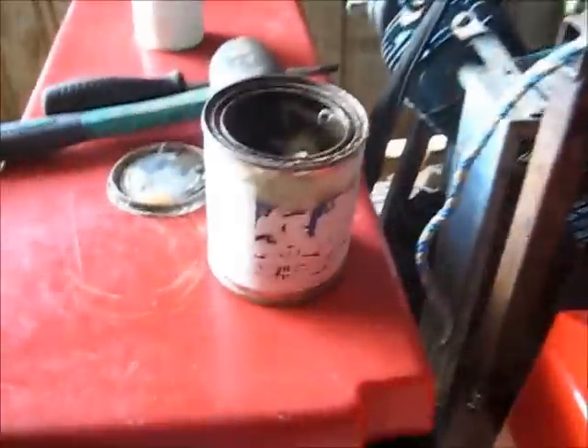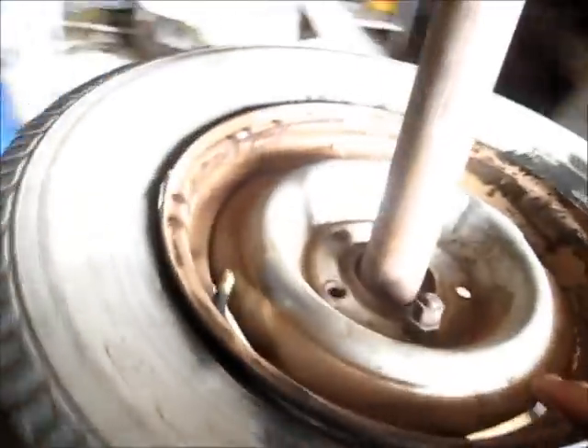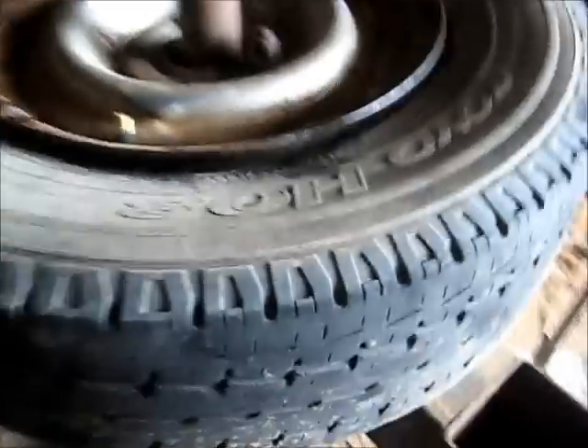With all these tyres, they're so much easier to fit when they're fresh. Good bit of piping lube — end into that, wind it in. Perfect. Just going to give it a tap, make sure the bead's evenly pressed. It's all pretty clean in there. Haven't damaged the tyre, so that's a much better tyre now. Nice. Give it an inflate.